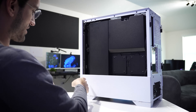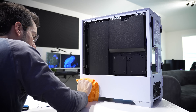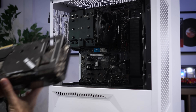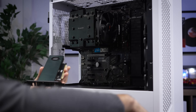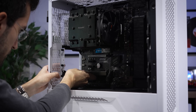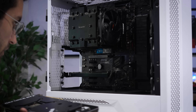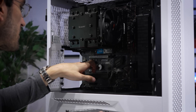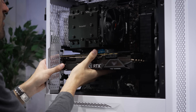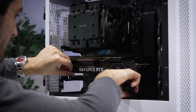This looks so much better now. I just noticed there's a little bit of a stain that was not removed with water or isopropyl — nope, another one of these super stuck-on ones. Eight hours later — finishing touches will be our PCI devices. I just noticed that this card, in order for it to have full slot connectivity, it's going to have to sit a bit higher. It could actually fit in smaller slots because of the way that it's indented, but I want to put it in a full-length slot — this is an eight-lane slot here. The only problem is that position puts it quite close to the graphics card, which I'm not a huge fan of. I'll let him decide on that one.